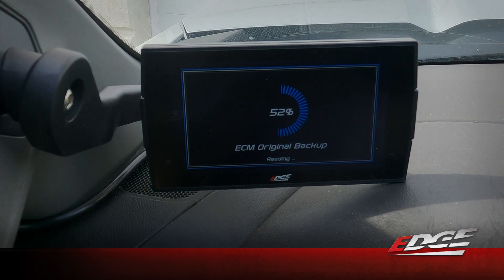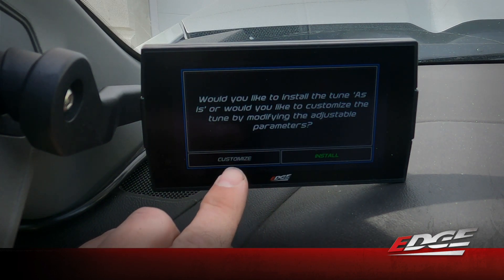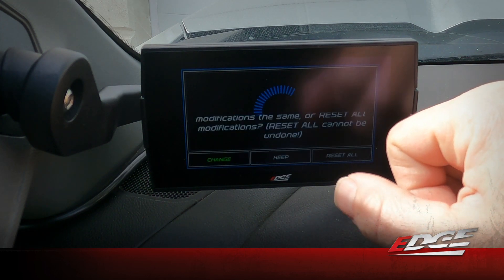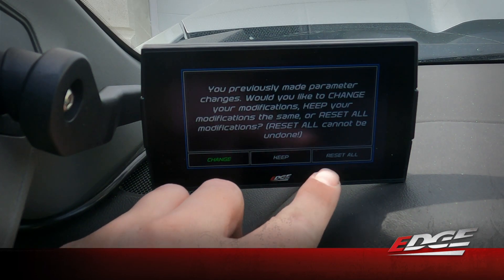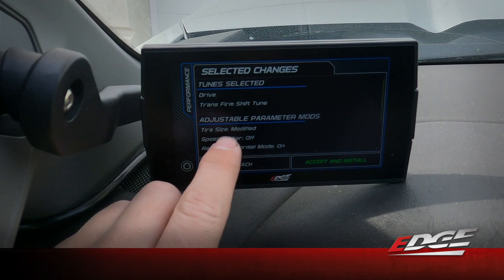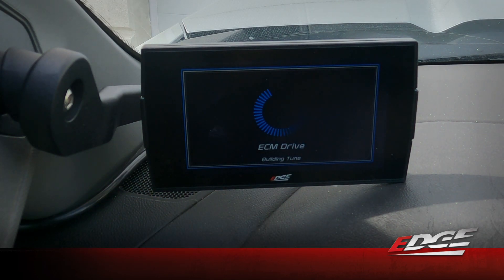We're going to select the drive tune with the firm shift, which is good for a daily driver and towing. We'll read the vehicle's data to confirm we're still working on the same truck. It's backing up all that factory data. We've already customized these once before, before the unlock. You can go in and select 'Customize' to confirm or make changes — make sure you've measured that tire height if you've changed tires. This says we've previously made changes: do we want to keep those modifications, reset, or change them? We'll keep those changes. It's got the drive tune, trans firm shift, tire size modified, speed limiter off, remember drive modes, throttle booster at 25. We accept and install, and now the device starts flashing those calibrations into the ECM through the OBD port. Remember, the unlock process only has to be done once.